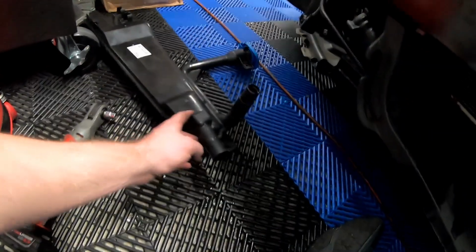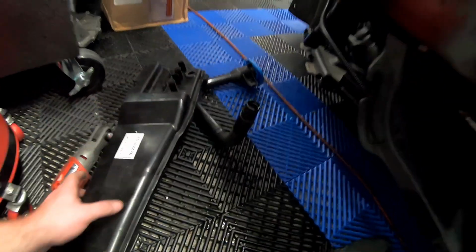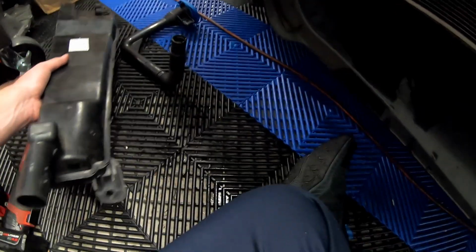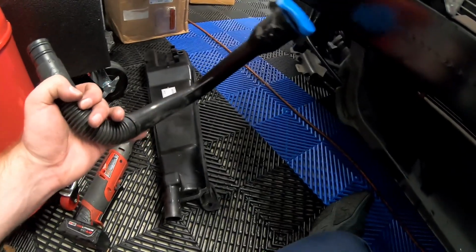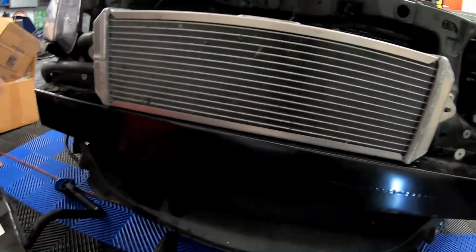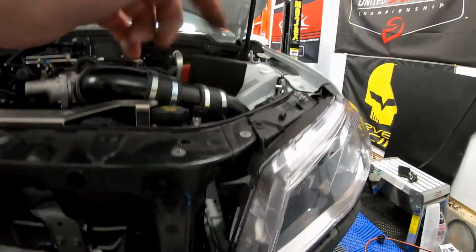So that's kind of the update. Oh, and also, guys, as soon as you unplug the pump in the back, the entire tank will drain. There's a nice layer of windshield washer cleaner on my floor right now, which isn't that big of a deal. But this is a 2-piece tank, so you can actually pull this out. There's some O-rings right here. Pull this out, and that will allow you to pull the tank out from the back behind the bumper, and that'll also allow you to remove the feed line going near the intake up here down into the tank.